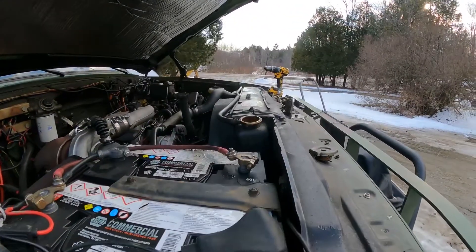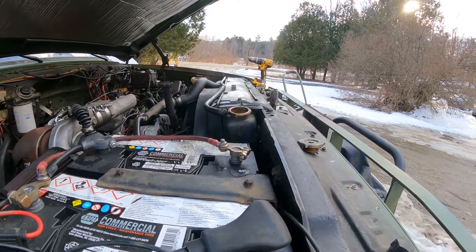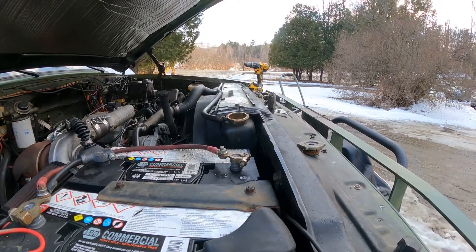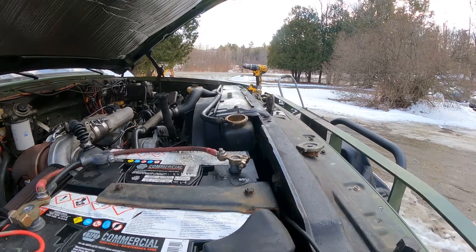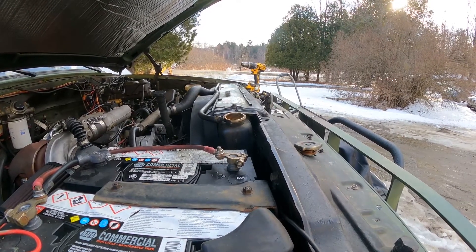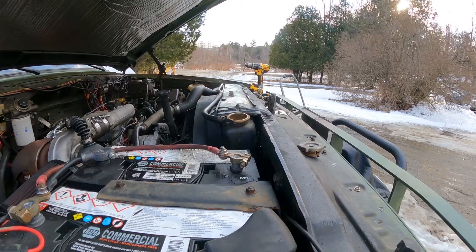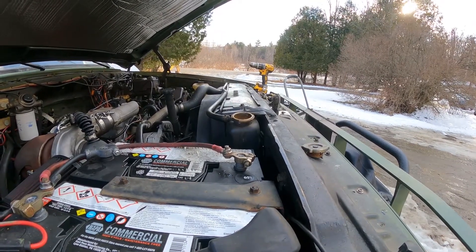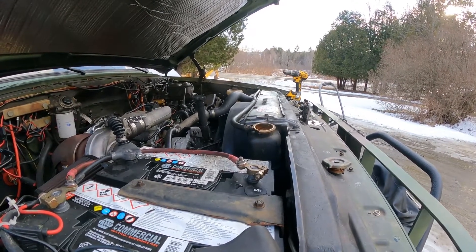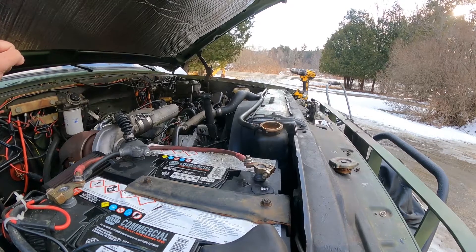Alright, here's what we have. It's hard to say how many rows that radiator is — maybe somebody who knows more about these things than I do. It's a stock radiator and it's steel, so it's quite a bit heavier, but at the same time it also cools down a lot slower than aluminum. So that's one reason for getting an aluminum radiator, and secondly the aluminum radiator I got is a four-row, which holds more coolant. I'm interested to see how that alone helps with cooling the turbo, because it gets quite hot. I could be just going around town and then once it's stopped at idle for more than a minute or two, that temperature really creeps up.